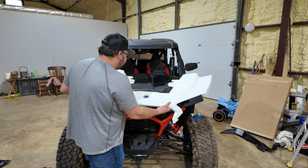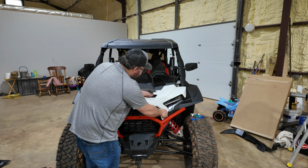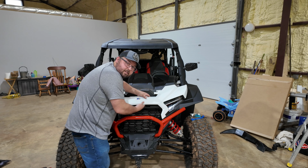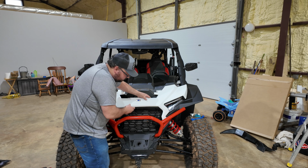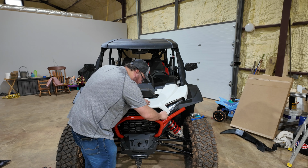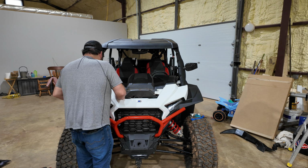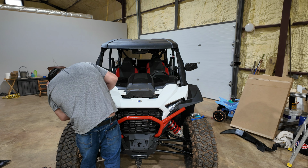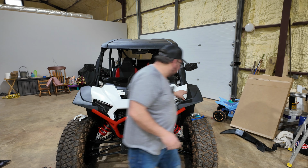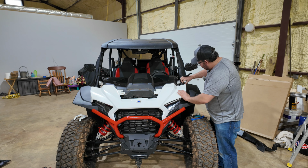All right, now we can throw this front piece on. And basically, you're just gonna get this thing pushed down and make sure you get these front lips here. There are like 2 lips up in here if you feel it. 2 little pieces to catch on the grill, along with these 2 in the bottom down here. Make sure you get those in place. And then on this front, you've got pieces that catch right up here in the corner. Like so.